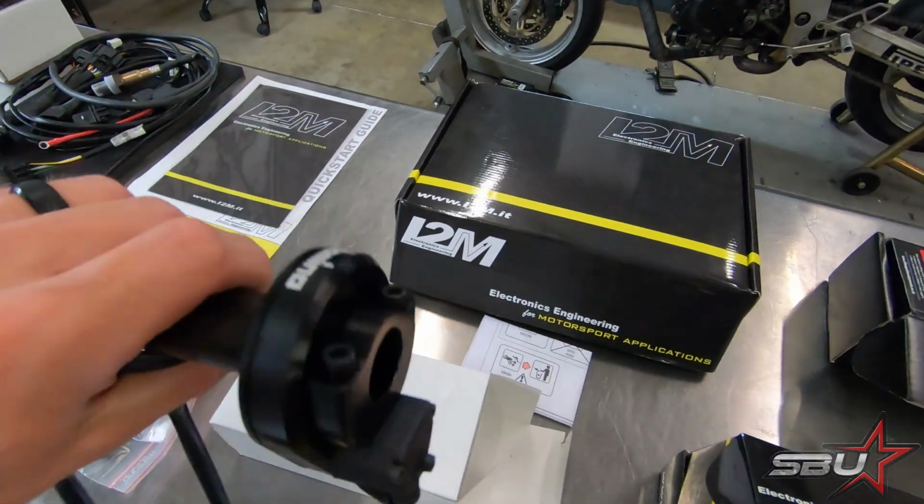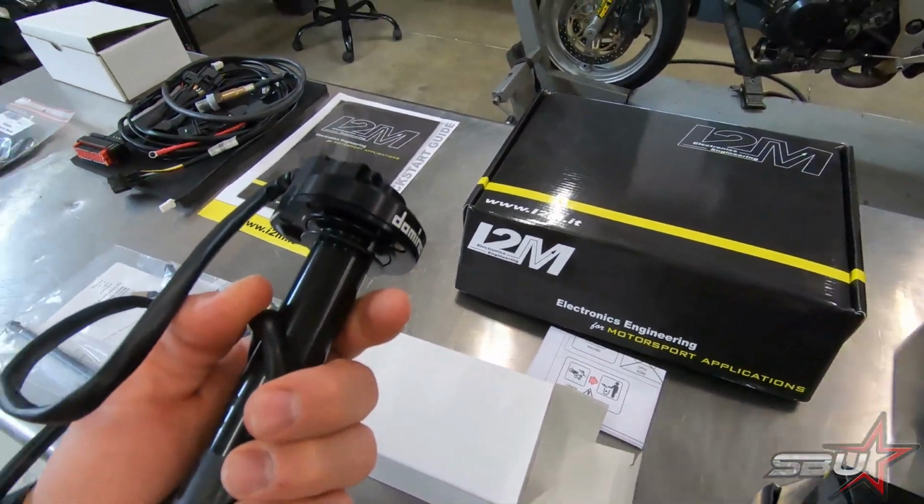This is a Domino ride-by-wire throttle assembly. The purpose of that is, for one, it allows you to separate the throttle housing from the stock switch pod, which if you've seen these from the factory, that's not there anymore. The stock one is all one big chunk of plastic, and it's not a very good design, unfortunately, for race use. When you crash, they almost always fail.